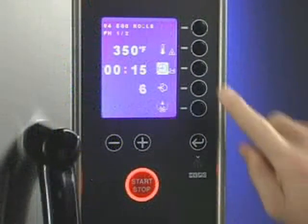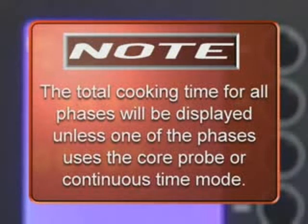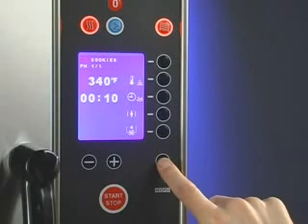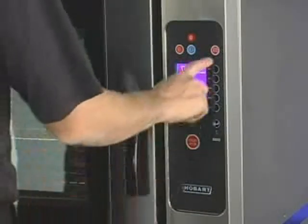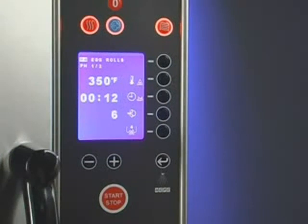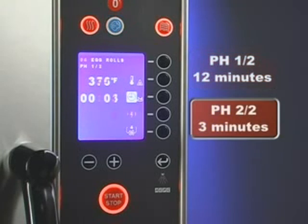During phase cooking, current time may be checked by pressing the line icon button. Note: the total cooking time for all phases will be displayed unless one of the phases uses the core probe or continuous time mode. To erase a cooking program, press the program button to select the program mode. Use the plus-minus buttons to select the program to be erased. Press and hold the enter button; the buzzer will sound and the program will be erased. To use a cooking program, press the program button to select the program mode. Use the plus-minus button to select the program number to be used. The screen will display the first phase of the program. Press the start-stop button to start the program. The total time remaining will be displayed and the buzzer will sound for one second at the completion of each phase.